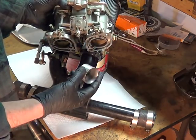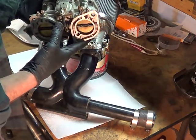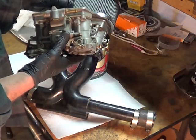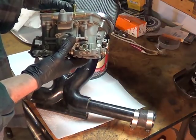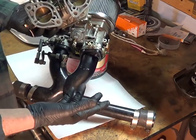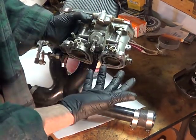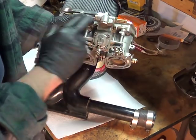Prior to fuel injection — nobody uses carburetors on new cars now — the Italian engine designers liked to increase performance by adding cylinders rather than increasing displacement per cylinder. They had the V12s, V10s, and all these multi-cylinder engines. So they would line these carburetors up, and that way they could run a radical camshaft and have a smooth-running engine, because in essence a Weber carburetor with two throats acts instead of having two carburetors — you have a common float bowl shared by two different cylinders.